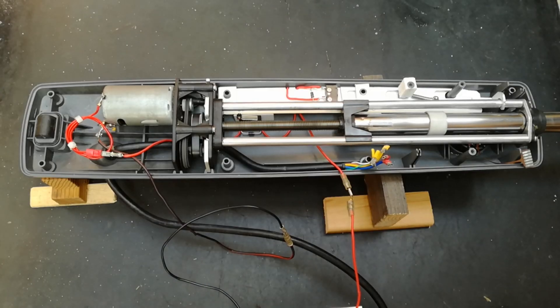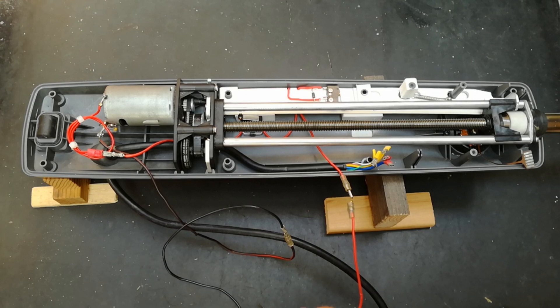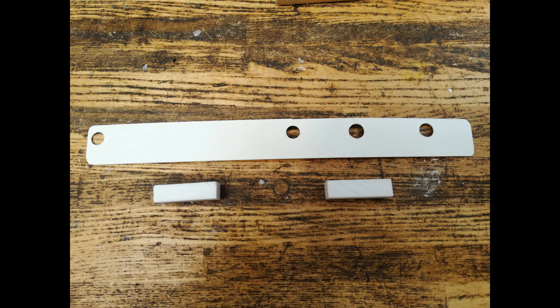So this is a very important part. Here is a limiting system that I've made up. Two micro switches limit the stroke on the outward stroke and also the inward stroke, and it solves all of the problems that this unit has. This unit is made up of a base which is made out of Lamin-X or Formica, to be as thin as possible. There are three 8mm holes and a 9mm hole drilled to locate the base onto the lugs.